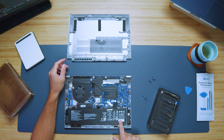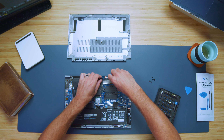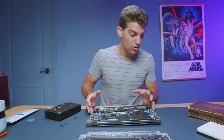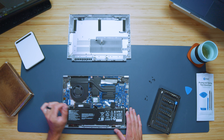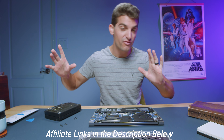Let's flip the laptop over, pull off the bottom cover and check out the upgrade path and the new interior. Pulling off the bottom cover, you can see the 74Wh battery — a larger battery — and we'll see how that does for battery life. The RAM is soldered to the motherboard so you won't be able to upgrade it. However, you do have access to the M.2 drive — there's only one slot, so you can't add storage but you can swap the existing drive. The micro SD card reader is therefore a nice touch for adding storage. With the newly redesigned thermal chamber, there's quite a large fan for this small 14-inch form factor, and I'm hoping it cools well without getting too loud.